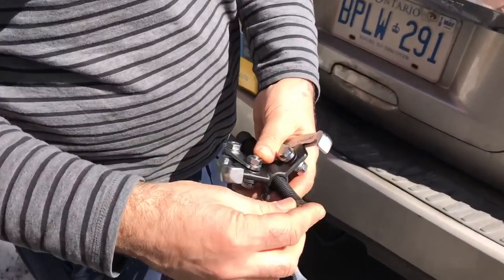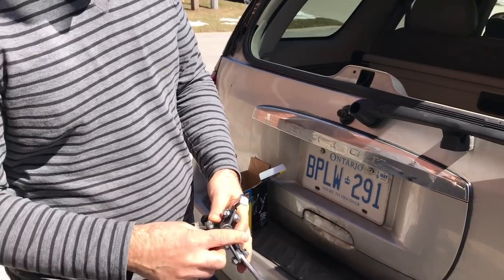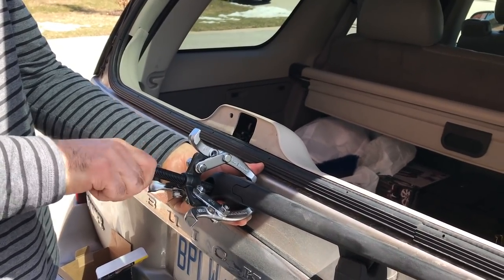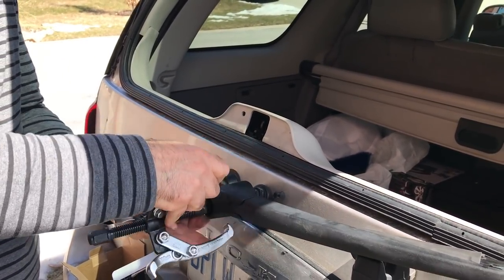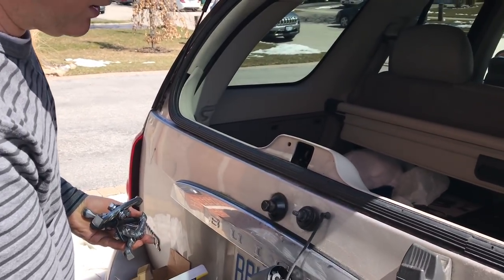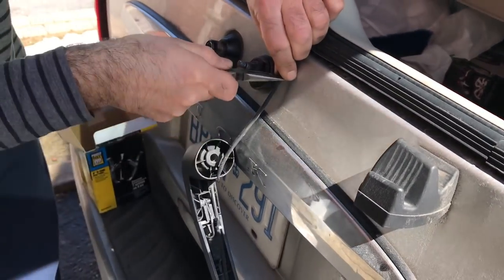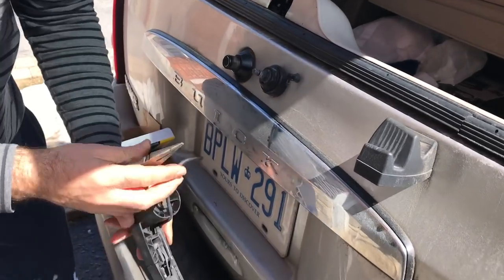I had to attach a little metal tip on mine because mine has a point on it, which isn't very good for pushing up against the bolt. What I did was I just taped this on and put this in here just to show you. Make sure your arms here are on the back, then start tightening this — initially just to get it snug you can do it by hand. Because I've already pre-done it, you can see it already popped off. Normally, you would have to use a wrench or a socket to get that off. So now we've got this off. You can remove this as well so the wiper is completely out of the way. This is the hose for the wiper spray — we're going to slide this off. There we go. We got the wiper completely off.